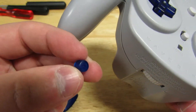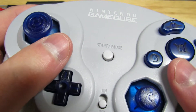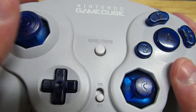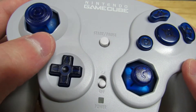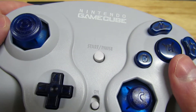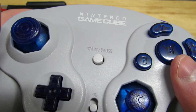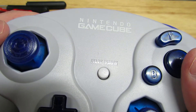As for the Start button, this may surprise you: the WaveBird uses a longer Start button, so you actually need the original longer WaveBird Start button for it to work — you can't use the replacement. The white actually kind of meshes with the blue, so that's fine by me. The buttons feel really, really good — a lot better than I expected given what I paid. I paid ten dollars, which is actually more than they normally go for, but I bought from Canada to get them faster.